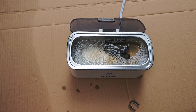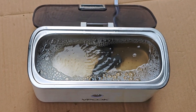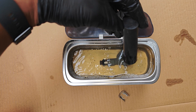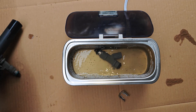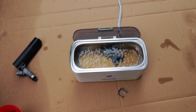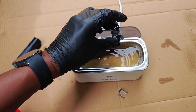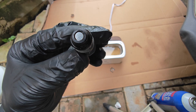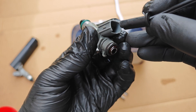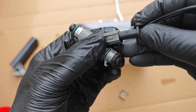You can see the grime lifting away, but I'm more interested in what the cleaner does internally. What I suspect happened is that dead gum or varnish clogged up the internal pintle valve, jamming it in place and preventing the solenoid from actuating. I ran two five-minute cleaning cycles. Note: even though you won't feel anything, don't put your finger into an ultrasonic cleaner while it's running due to the risk of damaging cells and tissue. After cleaning, a close-up examination shows the nozzles are clear — and when tested, it now clicks quite well.